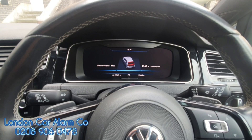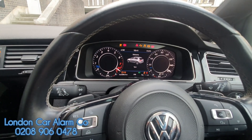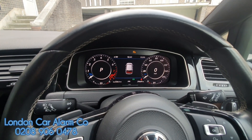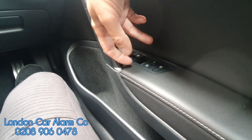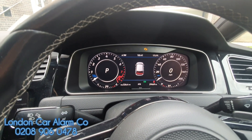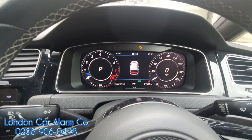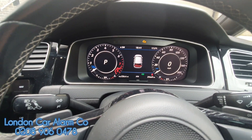Basically, first of all, you have to pass authorization by inserting the code, so let's just insert the code: one, two, three, four — basic code which we're going to change. Double flash. Now we're going to hit the driver's window up five times, which is the service button on VAG vehicles, so watch carefully: one, two, three, four, five. Watch carefully — we'll get five flashes.